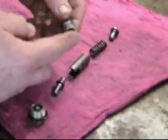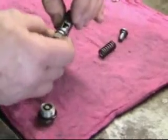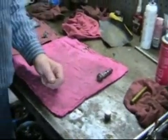Now that I've made my filter screen fit on the bottom, our valve goes in, our sleeve, our heavy spring, and our low oil pressure relief. Here's the whole assembly, and it's all set to reassemble. Now we're going to go ahead and take the solenoid out.